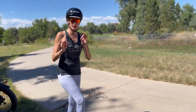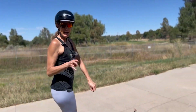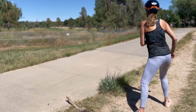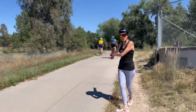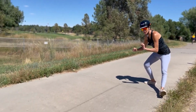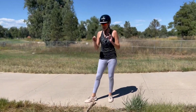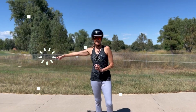And then with our hydraulic brakes, I started stopping at the same distance, but what happens with the hydraulics, they're going to lock the rear tire. And see, I started braking from over here, and can you see the skidding mark? So it starts right here, so my back wheel is completely locked, boom, and then it stopped me really hard here, which is a huge distance before the mechanical disc brakes.